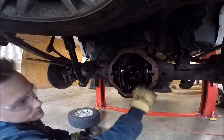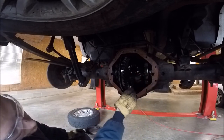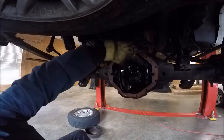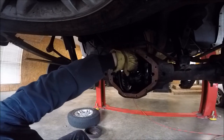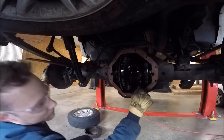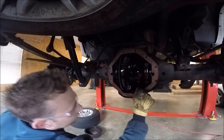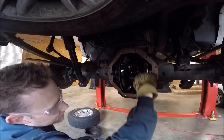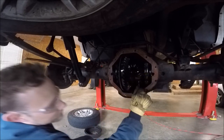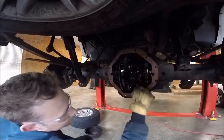But anyway, so you take this bolt out. This huge pin right there comes out. You push the axle in. Those axles come together and there's a little C-clip. Slide the C-clip off, the whole axle comes out. That's literally the only thing holding your entire rear wheel to your vehicle, a C-clip. It's a really hefty C-clip, but it still always blew my mind that that's the only thing. So when you go around the corner, the only thing keeping your wheel from sliding out is this C-clip.